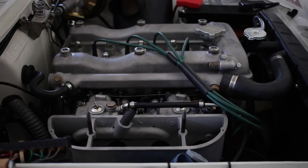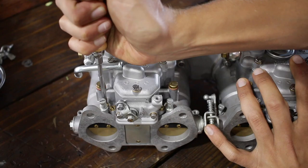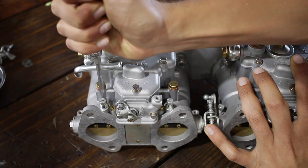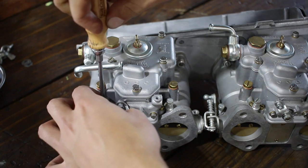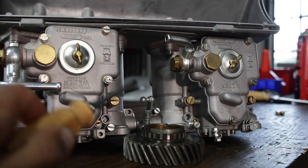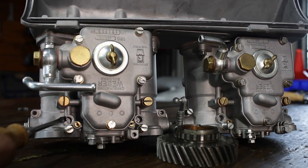I've checked both carburetors in the Duetto and I'm really happy, so I'm going to move on to synchronisation. I have a simple trick for getting the front and rear carburetor in sync – it's easier to film this with a set of loose carburetors. On each barrel of a DCOE, there is a cover for the progression drillings, which fuel the car at partial throttle.